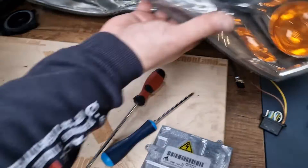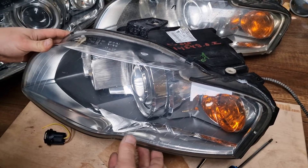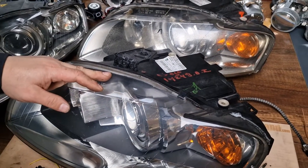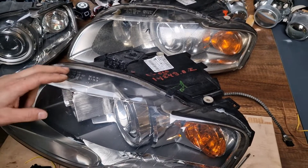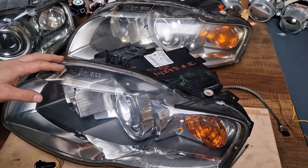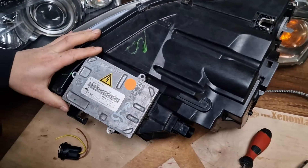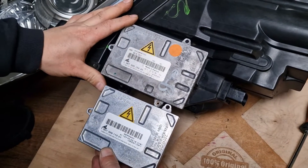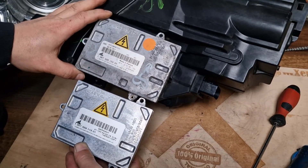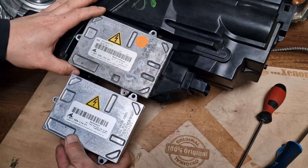Now let's see the adaptive type headlight. It's absolutely the same headlight externally, but internally different. It's very important to state that the non-adaptive type headlight and the adaptive type headlight are not interchangeable. The wiring is completely different, and the xenon system and main light module are completely different. If you look underneath the adaptive type xenon headlight, you will see a different ballast unit — a bigger one, about one centimeter longer — and completely different in terms of function. These two are not interchangeable at all.